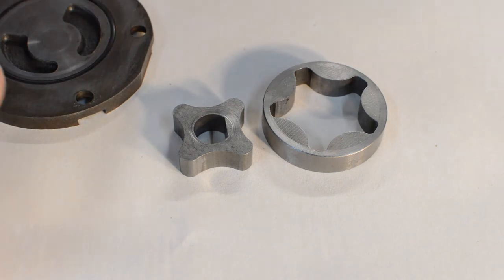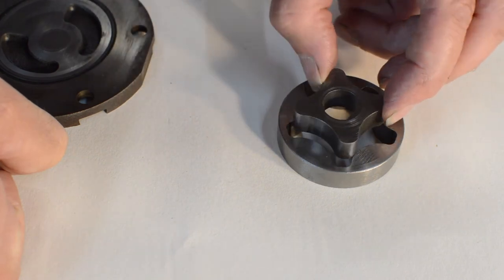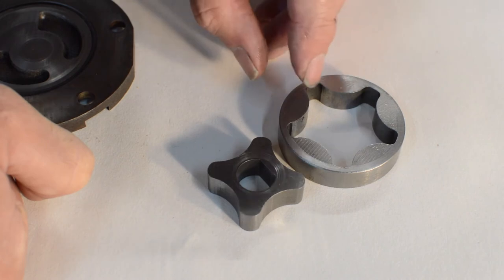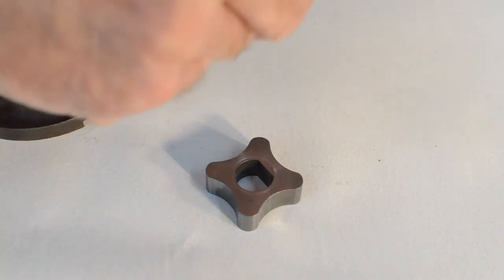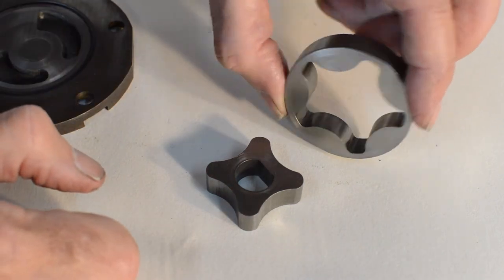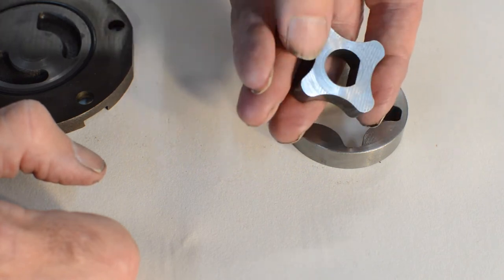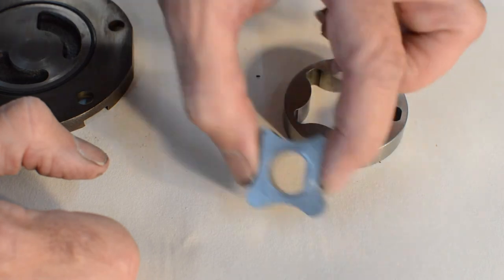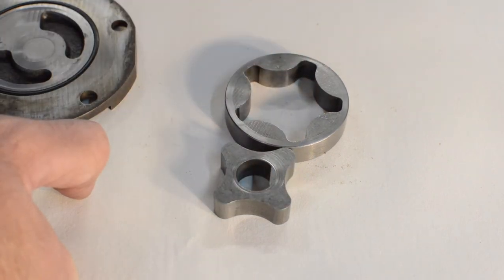The internals of the oil pump: you have the larger outer ring and then you have the inner which moves around inside there squeezing the oil around. The only thing to look for really is scoring. The inside edges are absolutely great - there's a little bit of crud still left, give it another wash. The edges are all pretty good, very minor marks but nothing of any consequence. There's no scoring on the faces - there's a tiny amount of marking but you can't even feel it with your thumbnail. So it is a good pump. In the workshop manual it shows you how to measure clearance for the pump, but frankly this is so good I won't be bothering.